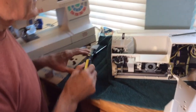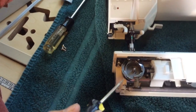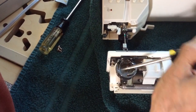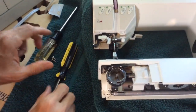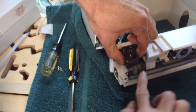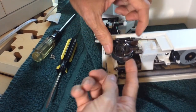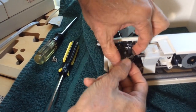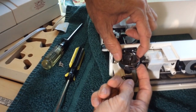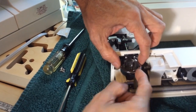If you look over here close up, this part that spins here is the hook shuttle, and I had a little tiny thread lodged in here — it was enough just to stop it. So what I did: I removed these three screws — tiny ones, one here, one here, and one there. Remove those screws. Do be mindful that this little piece comes around here, and look at it before you take it apart so you'll know how it goes back together. This rests on this part here — it's a spring-loaded thing, so when you take this off, it's going to want to drop down in there.